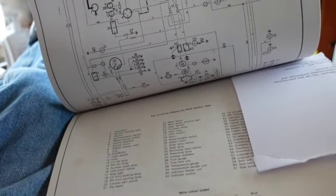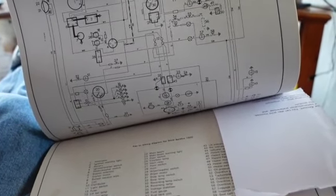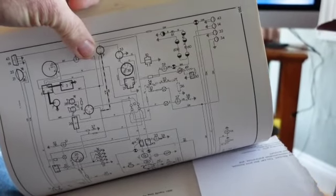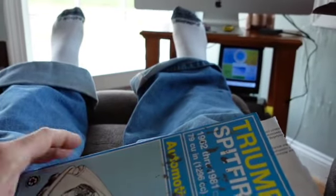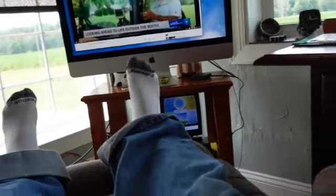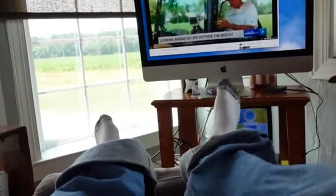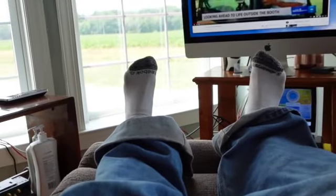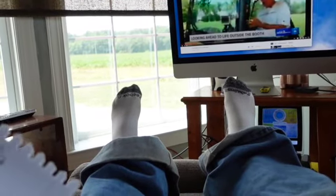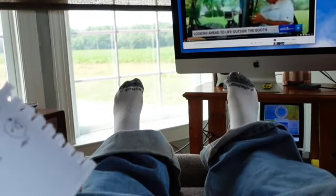This is just another version of the same thing. Sometimes you'll have a 12-volt battery with a 6-volt coil — it just depends. The issue here was cold starting and burning your points out. How do you get enough juice to your coil to crank your car and get the extra oomph you need to start it, and then knock the voltage down to keep it from burning your points?